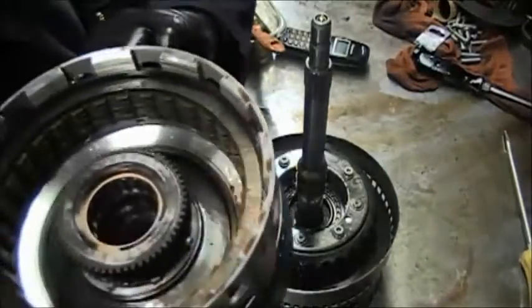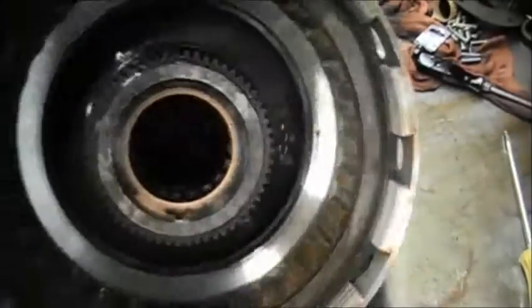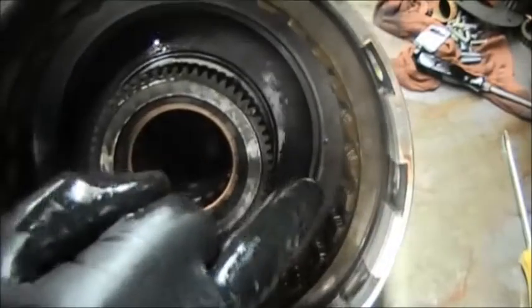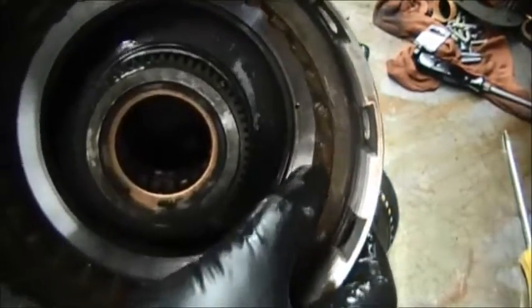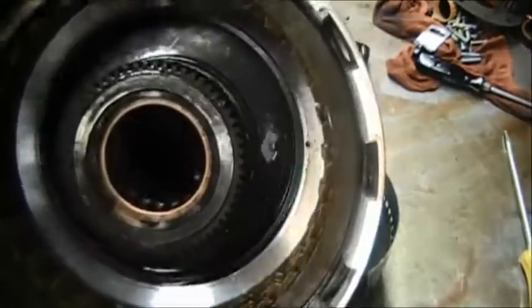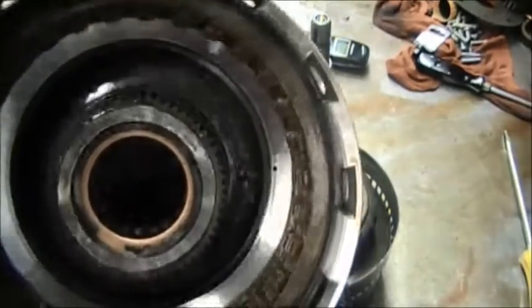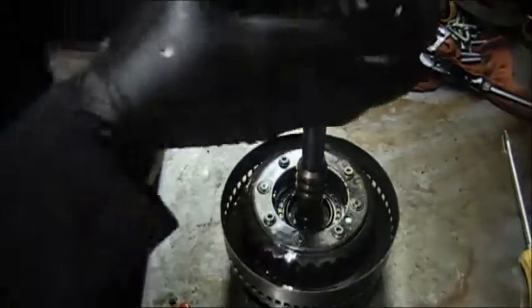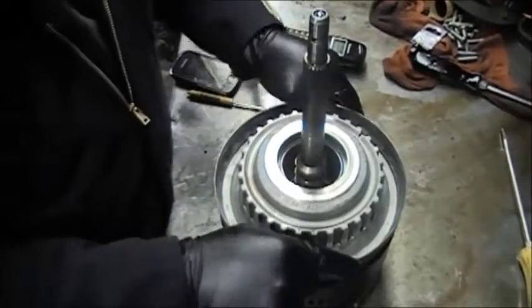If you see the clutches were aligned and you were all the way down — you can see how each clutch is straight and even. If you see a clutch plate that is off like this, see how one is not even? When you have them all even, you're all the way down. So put it in — that's good.